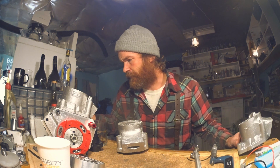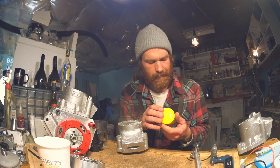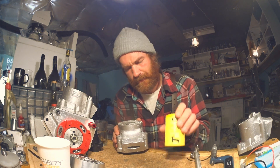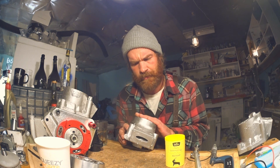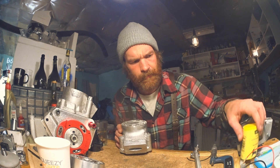I think I found a solution: ammonium bicarbonate — horn salt in Norwegian. It's fairly potent stuff and it shouldn't cause too much damage to the aluminium, but it should dissolve the plaster. So I'm going to try it. I'm going to do a little test with this stuff and see.